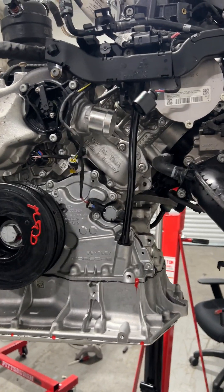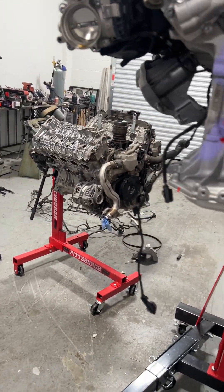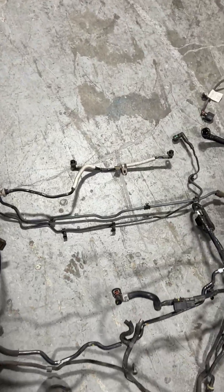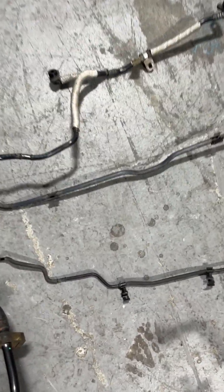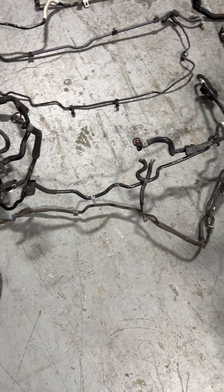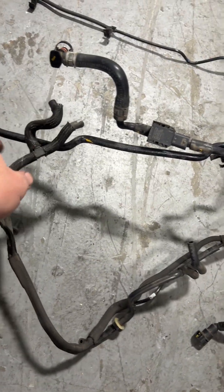So I made the decision to remove the wiring harness off the old motor, as well as the vacuum system and the coolant lines. It's got a couple different spider-type connections that run around the motor - whether they're cooling lines, vacuum lines, or the evap system for the oil separators for crankcase venting. They all come off in complete units, but it is a lot of work.